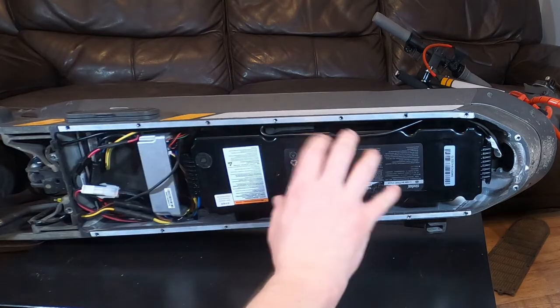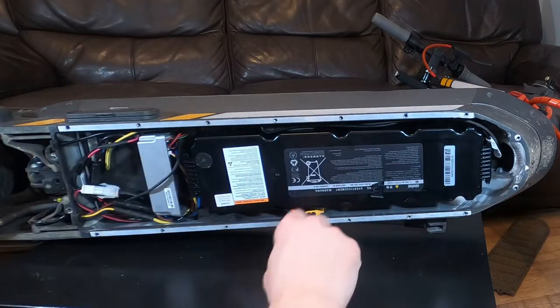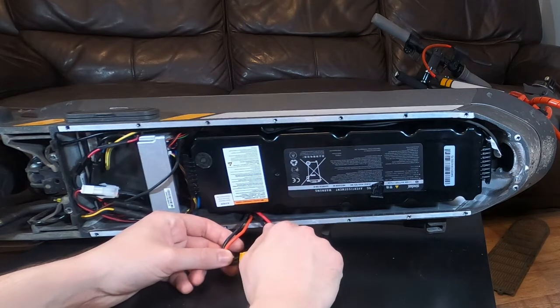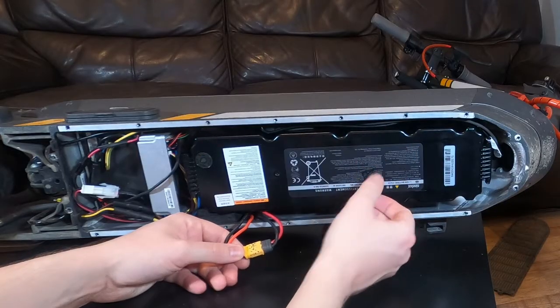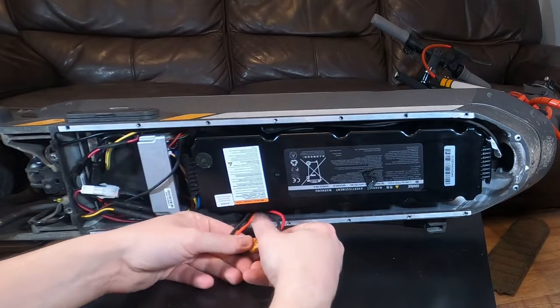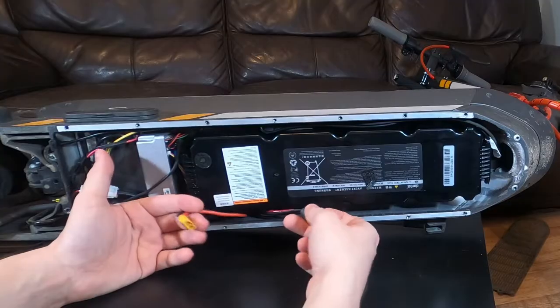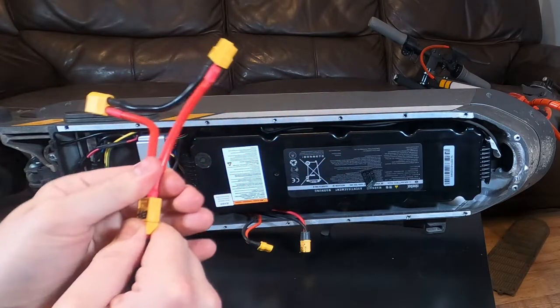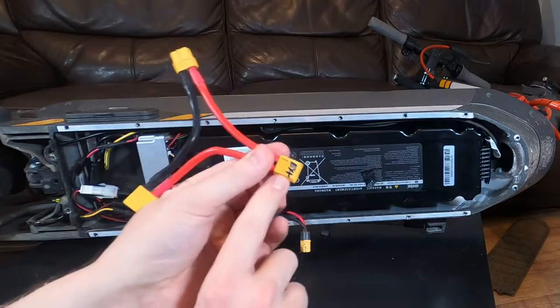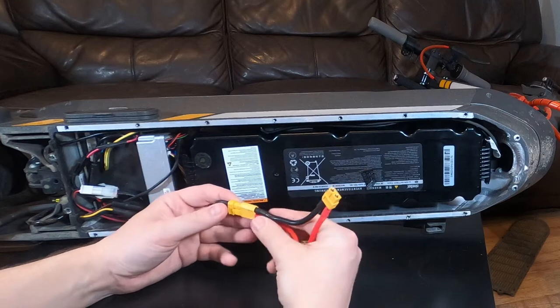So let's get this installed. I've got the cover off and just so that we've got it ready to go - down here we've got the main wire for the battery and all we're going to do is simply take off the tape and then pull apart the XT60 connector. On the main loom that you've got here we're going to go ahead and take apart this one here. As you can see he's written 'extender' on there and then these two match up with this from what I understand, so that should be nice and easy.